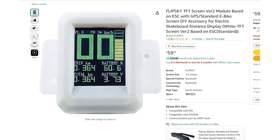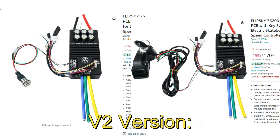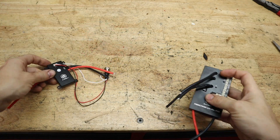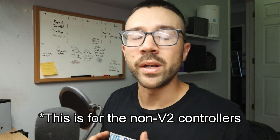Some things lacking on this controller that come standard on normal e-bike controllers are things like a battery level indicator or any type of display. Although you can get a display for a Flipsky controller, the ones they offer are very limited and not exactly made for e-bike builds. Also, there's usually no built-in switch to turn these controllers on or off, so unless you ordered one of the Pro V2 controllers — which come with a key switch or button — you'll have to separately get an anti-spark switch. For a voltage display, you'll need to find another way of tapping into the battery readout using a switch.